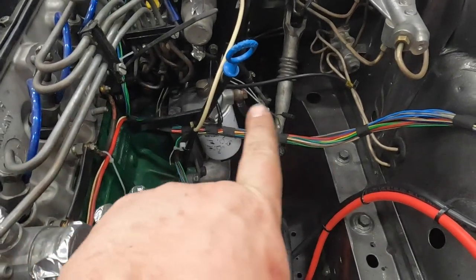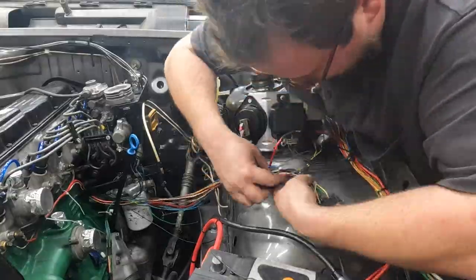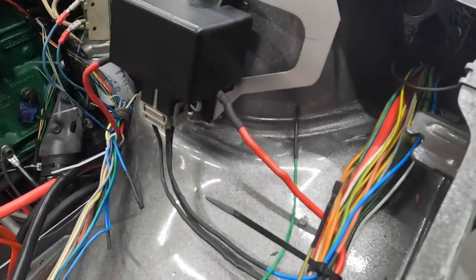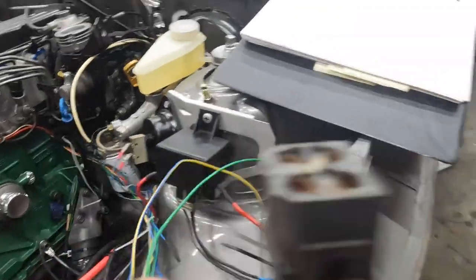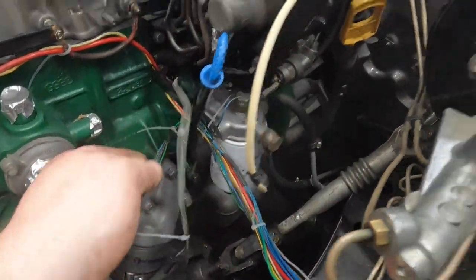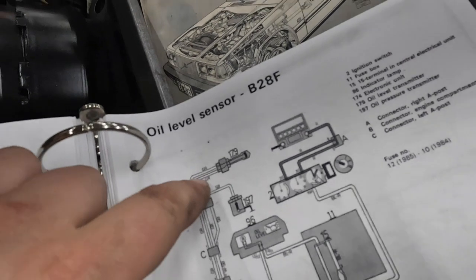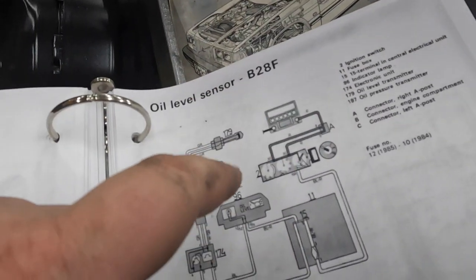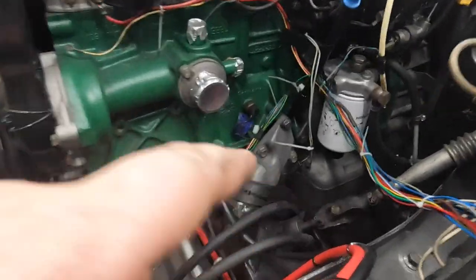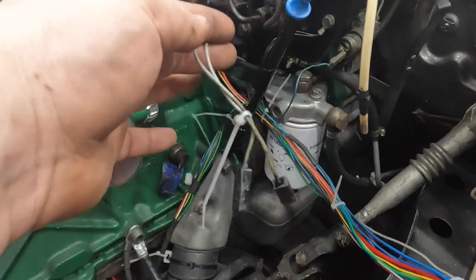I'll go ahead and get rid of all the EGR nonsense from the injection pump and cap and stow those wires somewhere around there for the same reasons. I ended up capping some wires that went to the EGR relay which wasn't necessary. The only wiring left to clean up is these two little gray wires. I've peeled through the whole manual time and time again — the only thing I can find with two gray wires is an oil level sensor for the B28F, which is not the inline-six we have here. As far as I can tell, nothing's ever even been plugged into these, so I don't think I need them and they can go away.